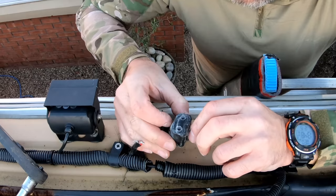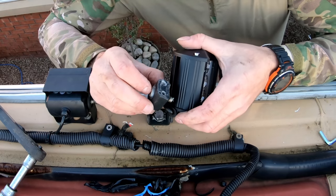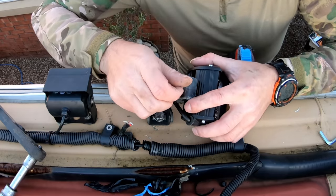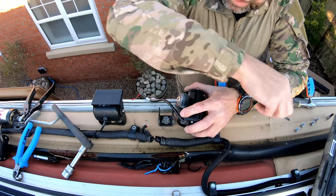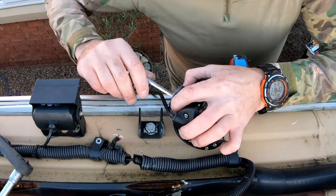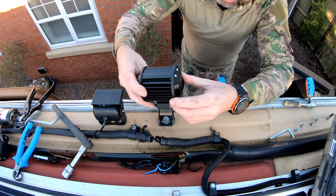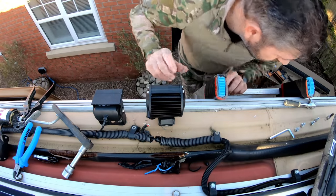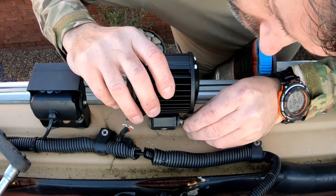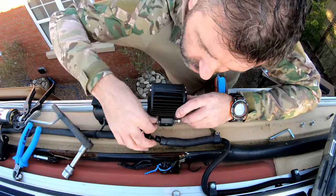Now the other half of the bracket — they come with this mounting block, and that wants to be mounted on the underside of the light. So I'll screw this allen key bolt into that captive nut inside that light, setting that up, making sure it's all central. Now I'll slide that mounting block inside the prongs of this bottom mounting bracket and fit four allen key bolts into that mounting block — that will clamp it onto the bottom mounting bracket. It's a bit of a fiddly job.